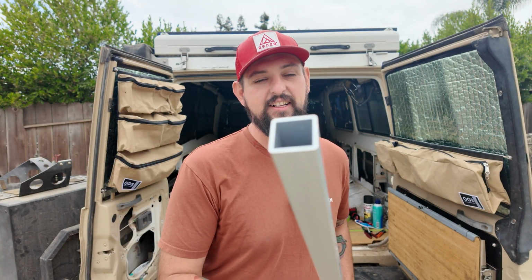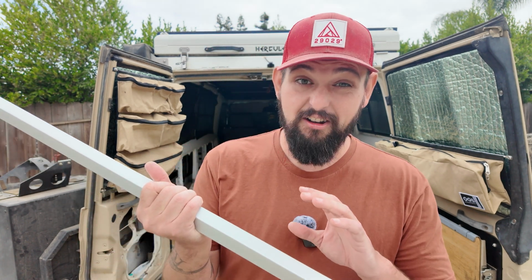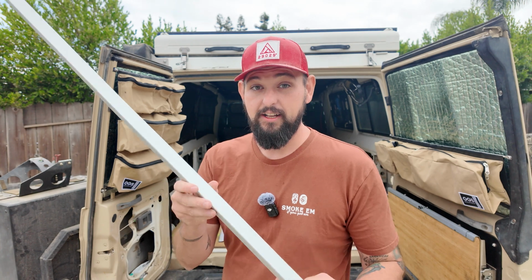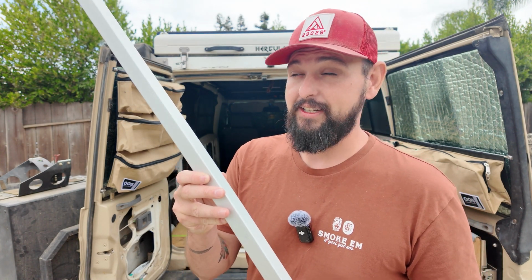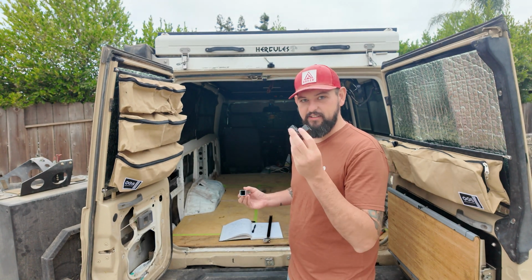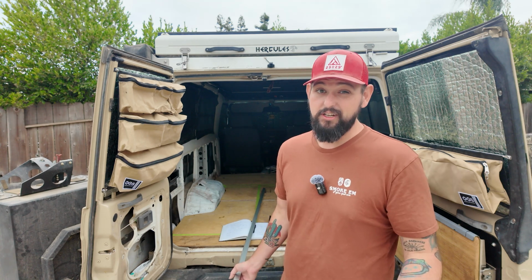So this time around, we're using a different extruded aluminum profile. Also from 80/20, this is called Quick Frame, and it's a 1" by 1" extruded aluminum profile without those T-slots in it. So instead of using bolted connections everywhere, like with the T-slot profile, the Quick Frame actually uses these. They're kind of like butt connectors. The profile has ridges on the inside here, and you drive these in there, and it's supposed to create a pretty nice friction fit. You can get these connectors in all sorts of different form factors.